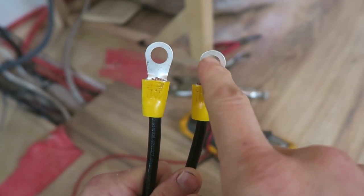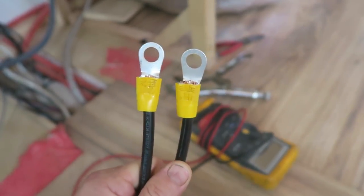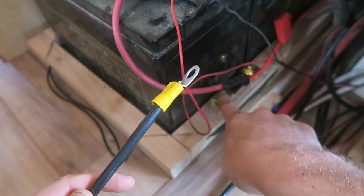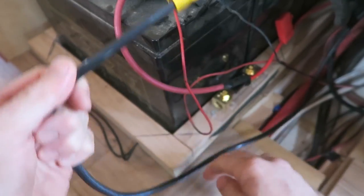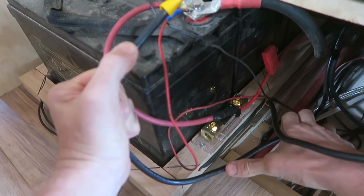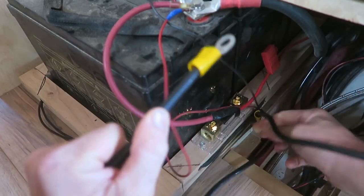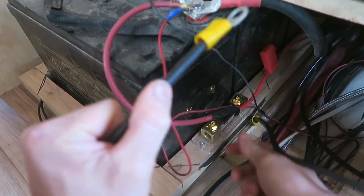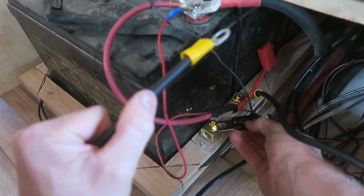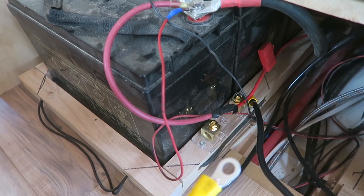Now that my 12-volt wires are prepared, I need to add a fuse link. I've read numerous times that you want to have the fusible link as close to the batteries as possible. So I've got the batteries here, the wire set up here, and I've marked a little line right here so I can cut it there. This piece will go to there, then I'll run the hot part of the wire to the fuse block, and when I'm ready I'll just insert the fuse to connect the fuse block to the batteries.